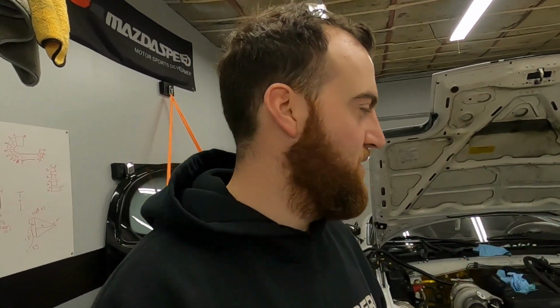So I had an epiphany after the last time I talked to you guys, which was now 2 days ago. It's Sunday. I crawled under the car because I knew when I put the crossover pipe up, there was some adjustment room where the crossover pipe sat, but it was still pretty snug. And I remember a year ago when I put the 5-speed in, they said if you had a 6-speed, you had to grind this little notch down in order for the crossover tube to have room to move. So I looked at it, and I think if I grind that down, which I haven't done yet, I will be able to fit the crossover tube up without any more modification or adding material to the downpipe or anything.